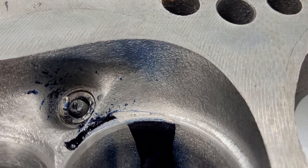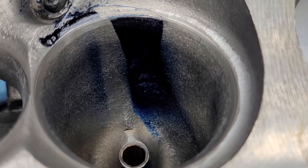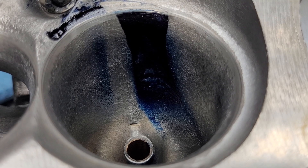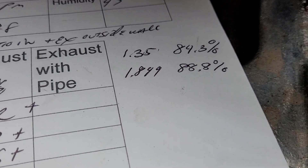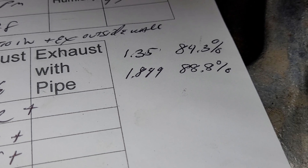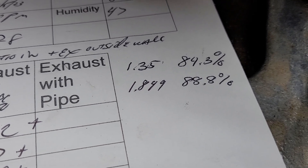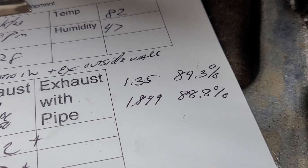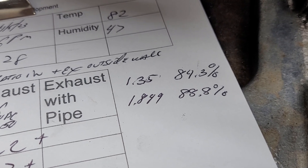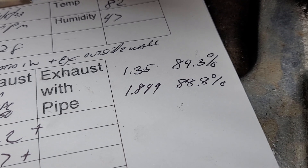What was actually done is I took a piece out of that chamber and a little bit out of the throat - changed the shape of the throat a little, opened it up just a touch. On the exhaust we now have an 84.3% throat ratio. I'm measuring the throat at the minimum of the port as it's going down from the seat. A lot of guys measure it at the bottom of the third cut, but this doesn't have a third cut - it's radiused in.